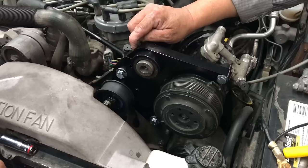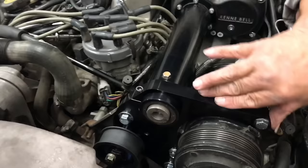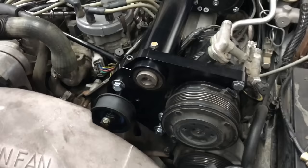On the blower snout, right? Then you tighten this down. Then you tighten down the rest. If you tighten down the rest and then try the snout, you can bend the snout down. Nobody wants a bent shaft.